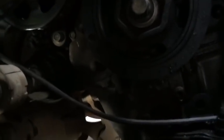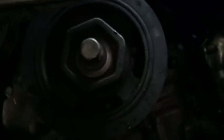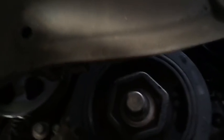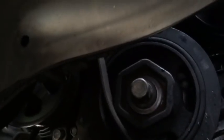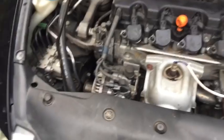Now, there is a front tab in there, but I'm going to just pull it down enough that I can see my crankshaft pulley. I can see the bottom of my pulley for my power steering, and where my belt's going to have to roll back up over in between these, so I can take my belt and feed it through those and up onto my tensioner. This will help me route my belt and get everything in place.